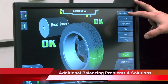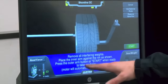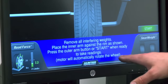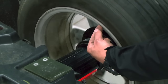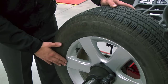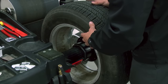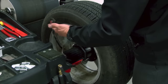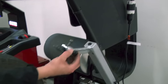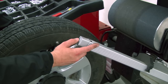At this point, it's important to just read the screen. After I press centering check, I'll see information come up telling me what to do: remove all interfering weights, place the inner arm against the rim as shown, press the outer arm button or start when ready to take the readings, and the motor will automatically rotate the wheel. I'm going to scan my outer flange and the inside of the outer flange to make sure it's clear of all weight or debris. As we saw earlier, this wheel has no outer lip for the weight to set on, but just give it a quick scan anyway.